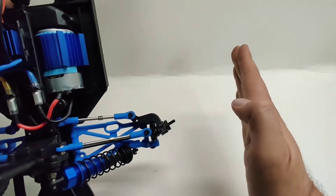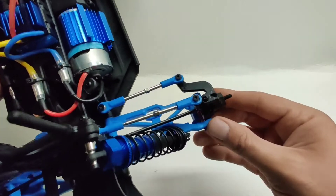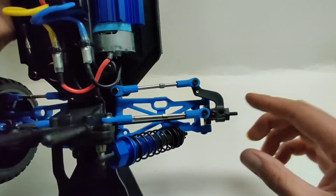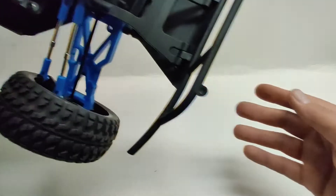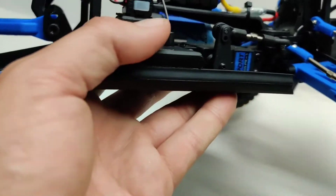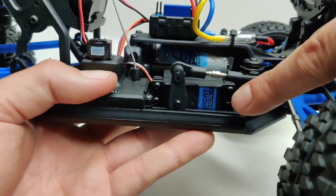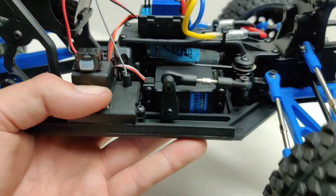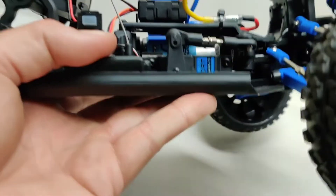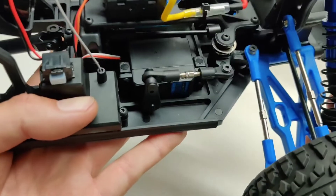As you turn, it's going to curve — it'll go really quick and you can get some aggressive turn-in. The only thing to be careful of is not to overturn these axles or the actual servo itself. Set your end points so you don't damage the servo. The servo is a standard size servo, probably just a generic brand made in China — they've got a SESR1 Sport on there. The servo saver is not adjustable; it's just a fixed spring. Not crazy about that.